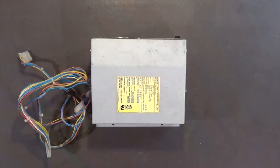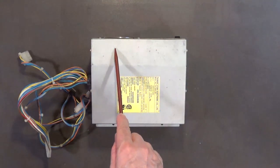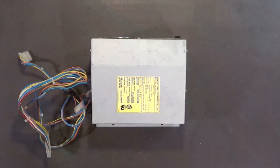My plan is: once a spare is recapped, cleaned, and fitted with a new fan, I'll swap it into one of my Amiga 2000 computers, pull that machine's original power supply out, and then close the computer back up. I'll print a label noting the power supply has been recapped and has a new fan. I also want to show the proper way to do this, because there are videos on YouTube where people have done it wrong — installing the wrong type of fan.